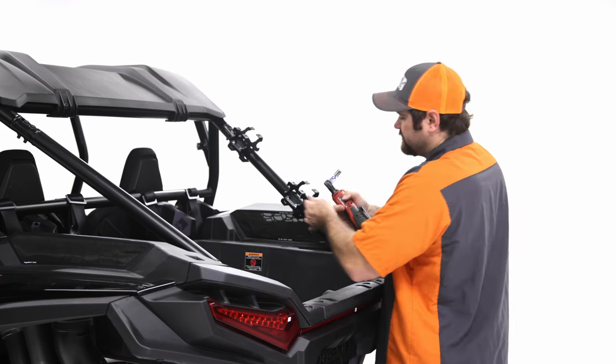you're gonna have to grab that quarter inch Allen and the half inch, and you're gonna have to start tightening these bolts in the back. So once you're done tightening up your hinge brackets and you're happy with where your tailgate is at, you're gonna go ahead and grab the 3/8 box wrench and the 7/16 box wrench because we don't have too much more to tighten. But we're gonna now tighten this tailgate receiver bracket.